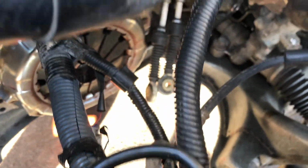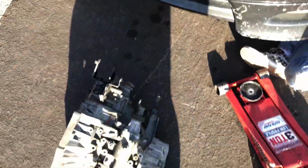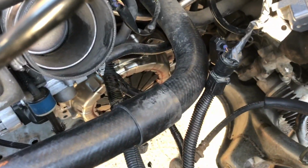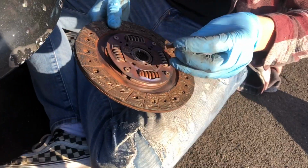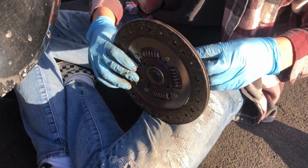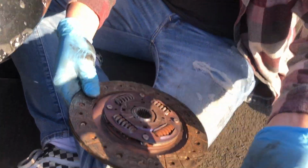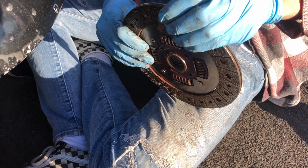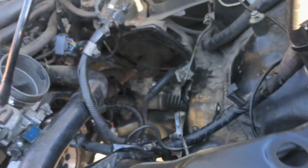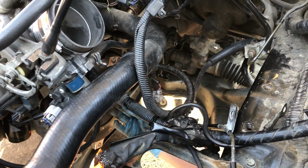Taking off the pressure plate. How was the bearing? Transmission's out. Throwout bearing looks fine. But see what happens. What happened? Seabass was a big dummy head, and look, see this piece? It got stuck right between the friction plate and the flywheel. I really hope that didn't mess up the... It was in the centerpiece, like right here. See where the ARP bolts were? It was sitting right here, and then when you shook it, it fell.